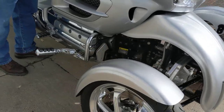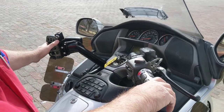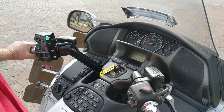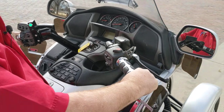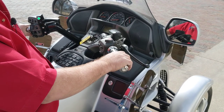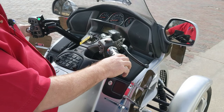What we've got here is a power switch up here. You can see — we turn that switch on and this bike is going to stand itself up and stay in the center position. As you turn it, it's going to lean a little bit, give you a little lean going through a corner. You get above six or seven mile an hour and this thing's going to shut off and it turns into just a regular bike. It takes a little bit of getting used to. It's on a really nice platform — of course on the 1800 Goldwing, we all know how bulletproof that is.